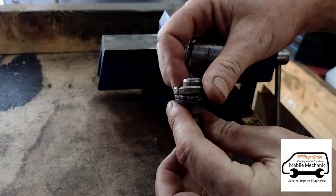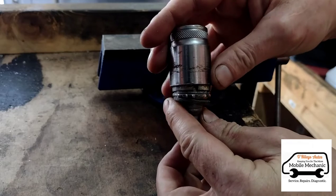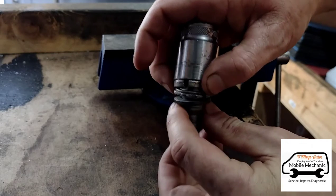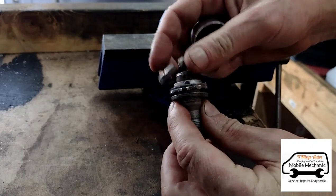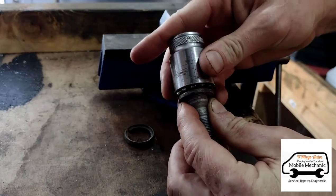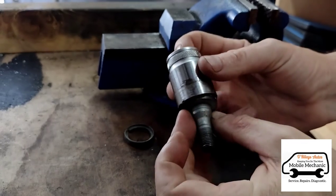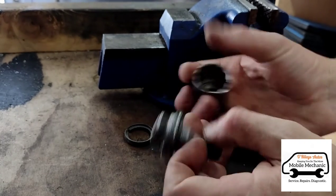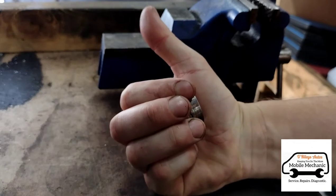So with this spinning sleeve — when that's on there, if we hammer just a socket over there, obviously the spinning sleeve will spin and the nut won't. So when we cut that sleeve off, we can then beat the socket over and it'll open nice and easy. Anymore, let me know — I'm sure we'll be doing plenty this week.